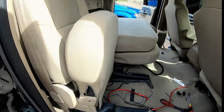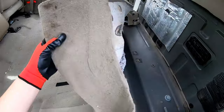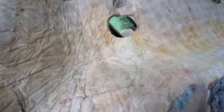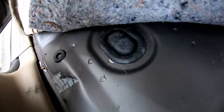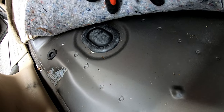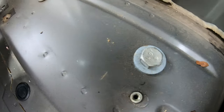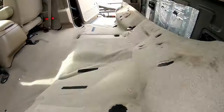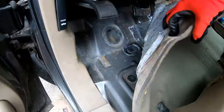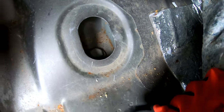After you've got all that done, go ahead and pull out your back seat. Now that you have your back seats removed, you can pull the carpet up. Right here will be the middle cab bolt — you're going to pull that rubber grommet out. Right here is the rear, same on the other side. Same thing right here in the front: you have your rubber grommet and your bolt is down in there.